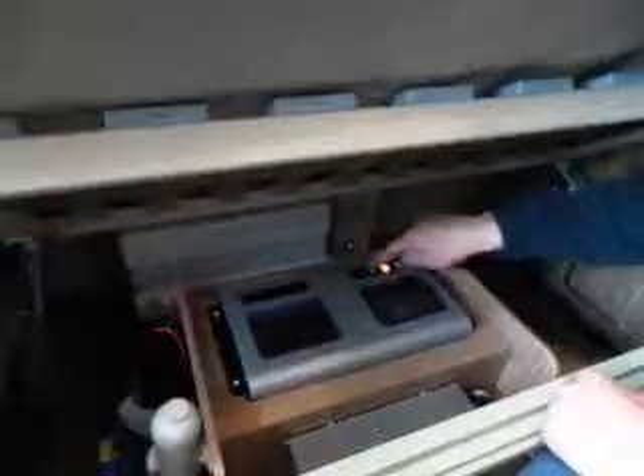There's a drain plug down there to drain your hot and cold water tank and taps. The consumer unit here provides heating and hot water. There's an isolating switch for your boiler, a spare switch, and a charger switch — with 240V connected and the charger switch on, it charges your leisure battery. There's also a reverse polarity indicator: if that light is lit when you plug in abroad, you'll need an adapter. This mainly affects continental Europe — most countries apart from the UK wire things differently.